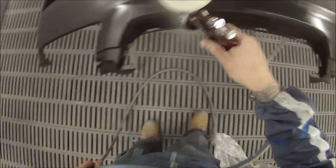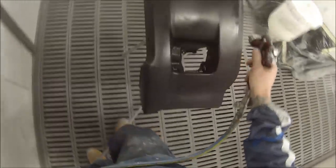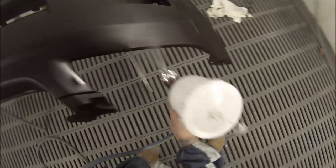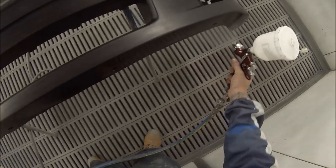Make sure you give them a bit of a rub down. Some people don't sand their bumper bars, but I've found you're better off if you do. Because if it comes back in six months with paint flaking off, you can turn around and say, 'I used plastic primer, I also sanded it down, I've done everything I can.' If the paint's flaking and it's not sanded underneath, they'll say you haven't done your prep work properly. It only takes a couple of minutes.